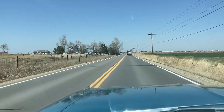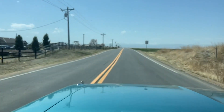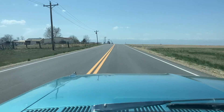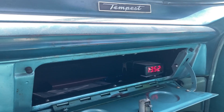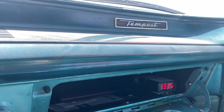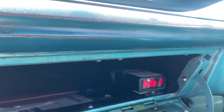The high-speed air bleed influences wide open throttle. A smaller high-speed air bleed will make wide open throttle richer, and a bigger idle air bleed makes idle mixture leaner. It's fat — you can just hear it, it's running overly rich, just sluggish. You can see it on the AFR: 11s and 12s, and then 13s when it comes back to idle. At this point I need to take some fuel out of the transition slot. I'm going to go down a jet on the primary, take a little bit out of the power valve control channel, and then when I get the primary side running right we can go back and take a little bit of fuel out of the secondaries.